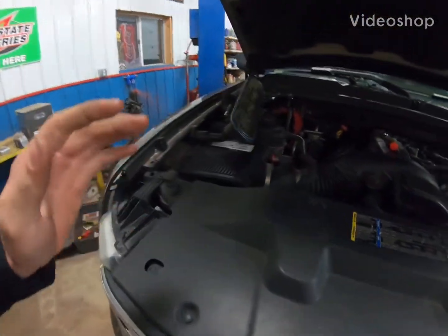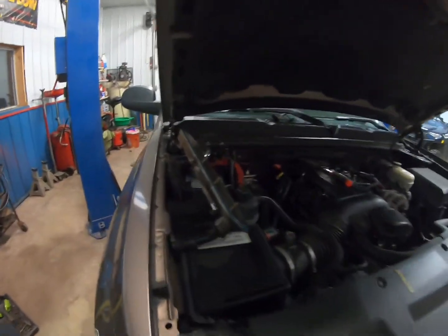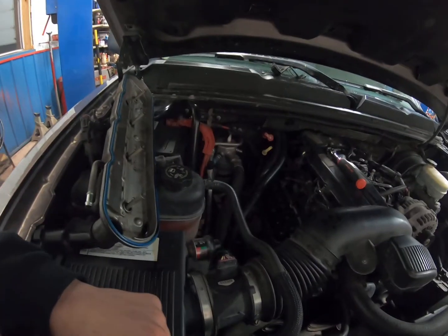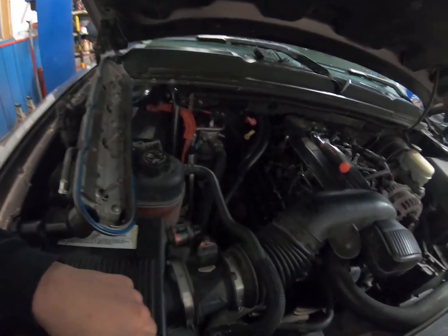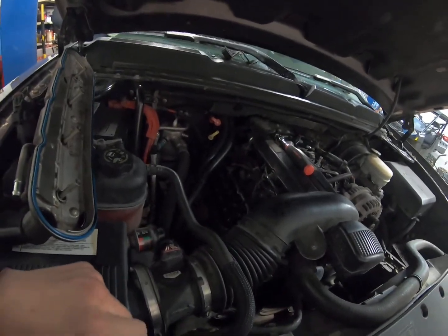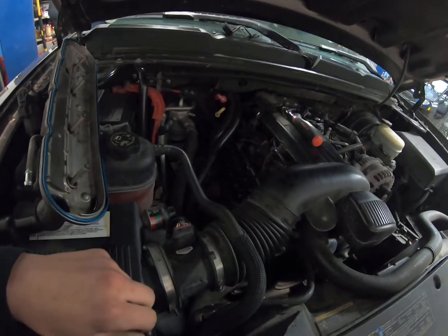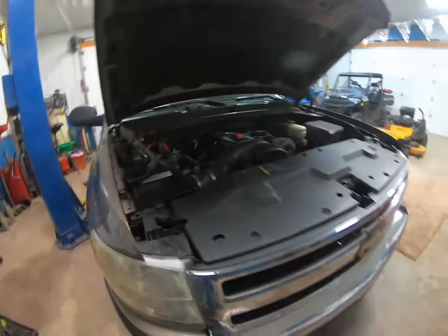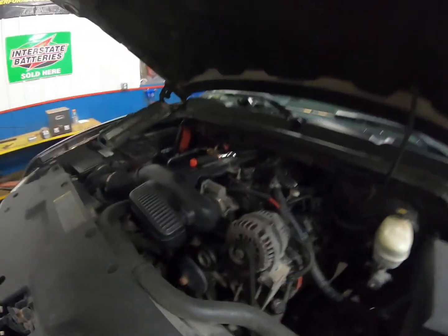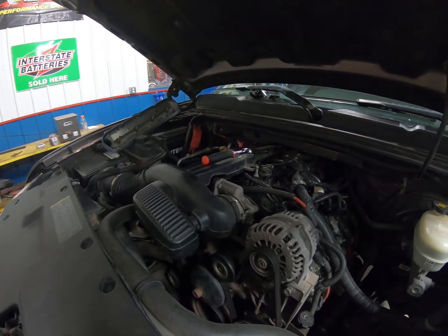All right, guys. So back with the two-wheel drive. I actually had my dad come out and look at it last night, because he's like, well, how do you know it's a rocker arm? So he came out and he pushed down on it, and it turns out that the lifter went bad again already. The same one I just did. So I'm not really sure if it was just a defect or what exactly happened.